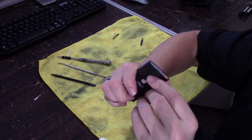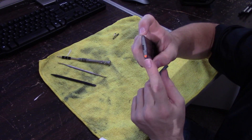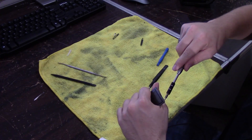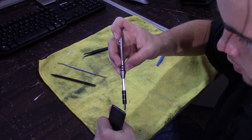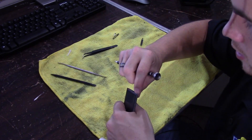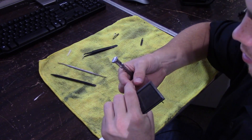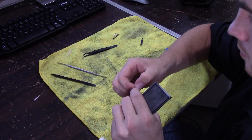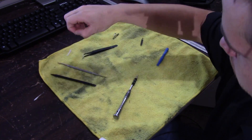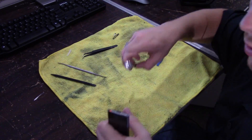The next thing to do — there are two very tiny angled Phillips screws in the corners. This is where that triple zero screwdriver is going to come in handy. Be very careful with these screws. They're very small, so if you drop them you're taking the extreme high risk of losing them. And when I mean small, I mean they're small and you can strip them extremely easily.